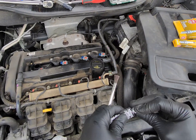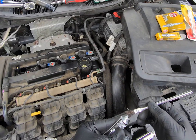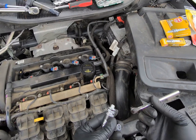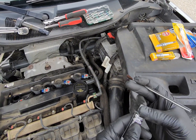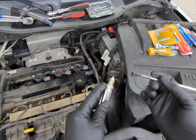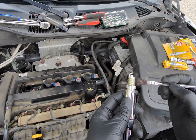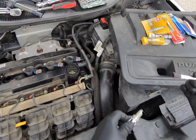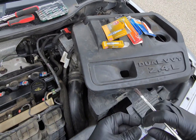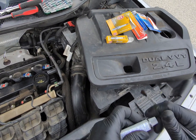Use the top of the cap, bust the seal. It doesn't take a whole lot, but since we're using spark plug grease on here, we would normally be tightening this up to 15 pounds, but since grease is literally a lubricant, we're going to take it down to 14. It's supposed to allow 10% less. A little dab will do you.